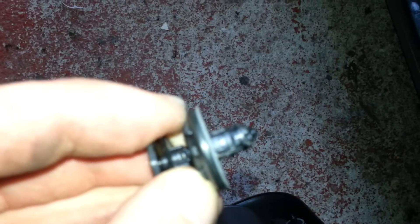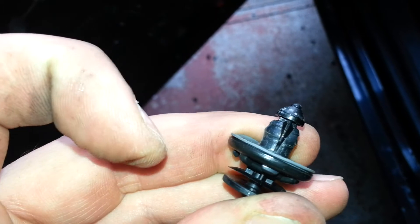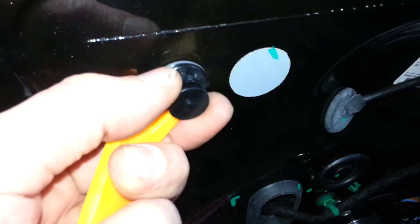There's a little plunger there — it pops in and spreads these clips. So what you want to do is, after you have the door panel popped off, a lot of the times these will be left in the door. So put your plastic tool in there — or anything at all, even a piece of wire wrapped around it — and pop them off, then put them back on your door panel ready to go back in.